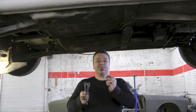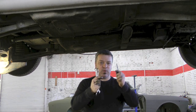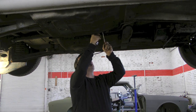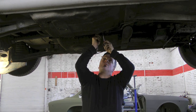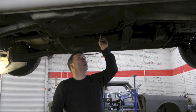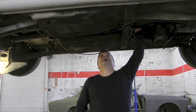The next thing I'm going to do — this isn't the torquing scenario yet — is snug down the driveshaft, first section then the second section, equally using the feeler gauge to make sure I'm not tightening one side of the driveshaft faster or closer to a mating surface than the other. There is very little room to work with on these. Trying to put a ratchet on this — there's nowhere for it to go because there isn't enough perimeter area. I felt it slightly snug, so I'm stopping there. I'm going to rotate it 180 degrees and snug down the other side.